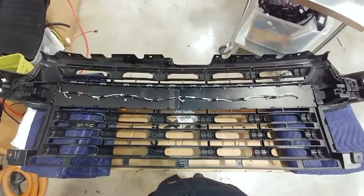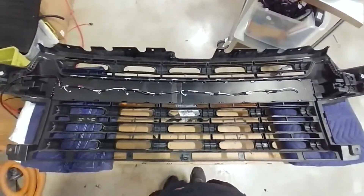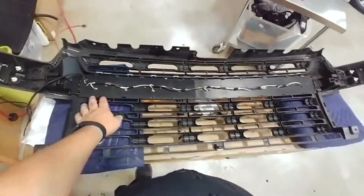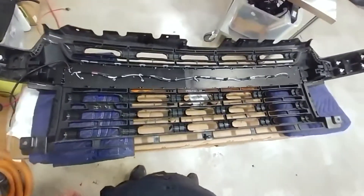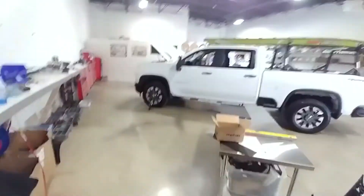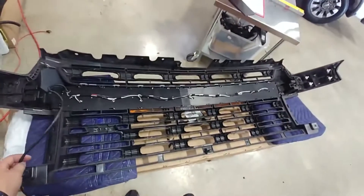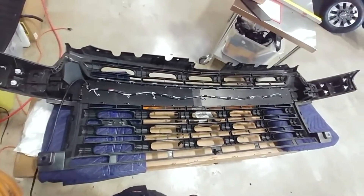Your results may vary if you want to trim it and try to get that perfect arc — go for it. Over here I've got my power and ground set up. I measured my amp draw on all nine lights all together. Guess what? 0.75 amps. So next thing I'm going to do is make up a plug-and-play connector for this wire to go in behind the headlight. That way this wire plugs right in behind the headlight there for marker signal, and this grille will be automatically turned on when the marker lights are on. That's step two in this process.